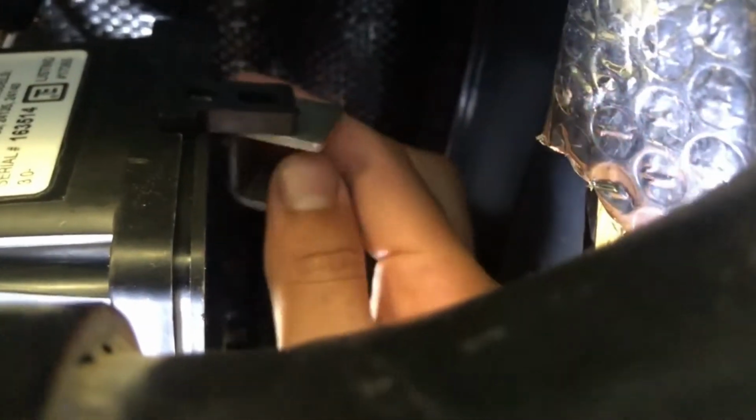All right, so as you're tightening those bolts down, this is a great place to make sure that you've got the proper spacing between here. It says 1/8 to 3/16 of an inch of space between here and here. Mine's a little snug, so they say you can adjust that by tightening that down a little bit more, giving you a little bit more space. What did I say? 1/8 of an inch to 3/16 of an inch. So just a little bit of space as you're tightening this down to make sure that you're good to go there. Okay, so just check the spacing on that, and then you're going to put your bolt in there, and you should be good to go.